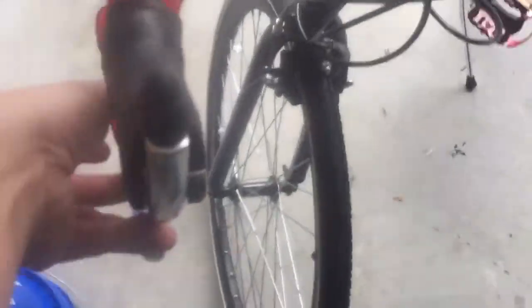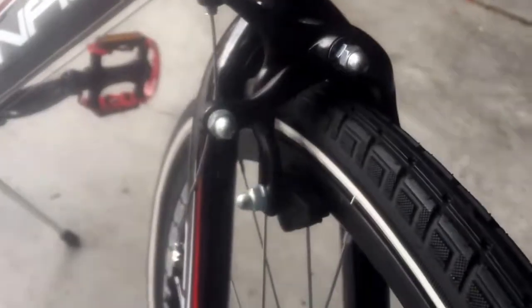If this is a young child's first bike, I recommend leaving the front brake very, very loose — otherwise they will flip over. On the back brake, make sure it's pretty tight. Make sure your seat is straight and tight as well; it's a 4-millimeter allen on this one. Put some air in the tires and you're ready to ride.